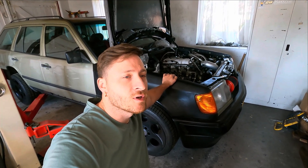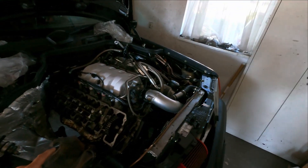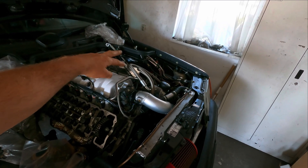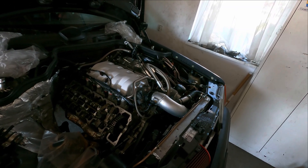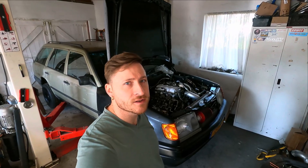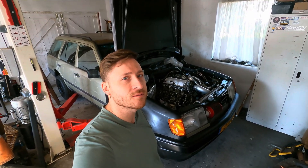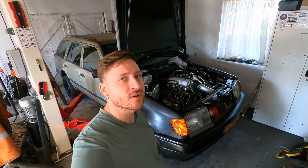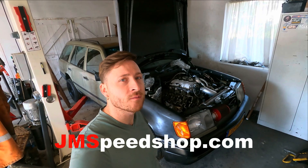It could have been much worse - there's no real damage in it. There's still the weird thing that I have darker spark plugs on this side, but that is, in my opinion, the less breathable side because the intake cams are closing early. Lots of things to consider and think about. If you've got any opinions or information that would help, let me know below the video and I'll try to read and comment on it. Thanks for watching, hope you liked it. Don't forget to have a look at my website. See you for the next video - bye bye.